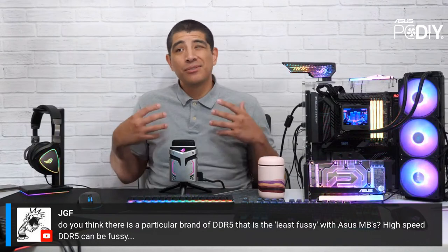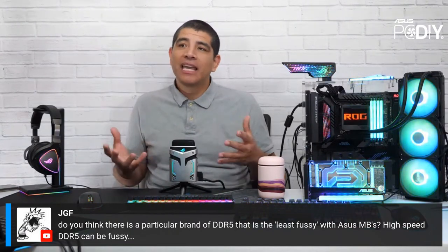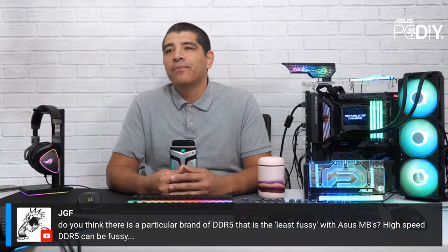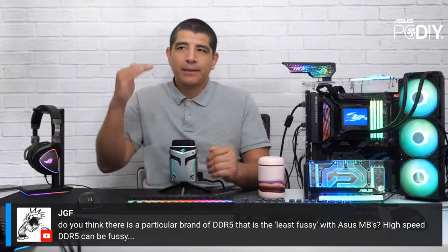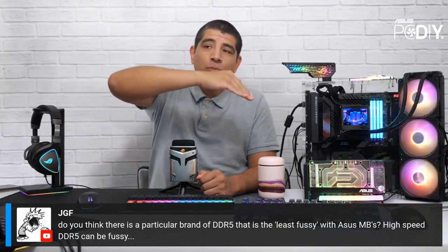And sometimes users have a really hard time understanding that, and sometimes they don't even want to accept it. It's hard for them to understand, because if you don't have multiple CPUs to test, how do you even know that the CPU is your limiting factor, right? That's why I tell people, be cautious. Once you break 6,000 MT, the likelihood that your memory controller is going to be able to support that starts to go down more and more.